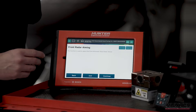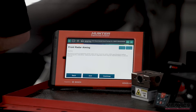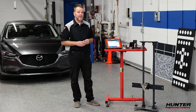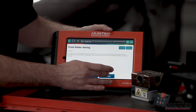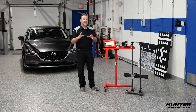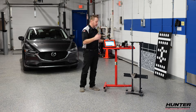Press continue — I have all that ready to go. This function will adjust the front millimeter wave radar. Verify and make sure that it was installed correctly. Hopefully the body shop has already checked and made sure this was installed correctly to OEM specifications, which can be found in the service manual. The bracket was replaced as well as the radar and everything was in specifications before they put the bumper back on. Perform this calibration anytime the sensor is reinstalled after removal — not just replacement, anytime it's actually removed. Also if a new sensor is installed, any parts near the sensor were damaged in a collision, or if it cannot see the vehicle in front of it.